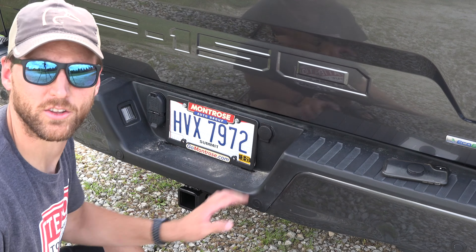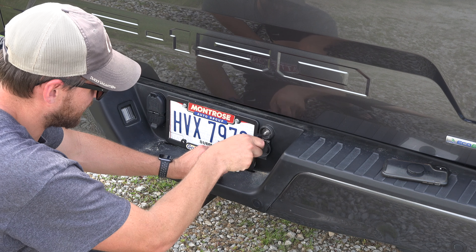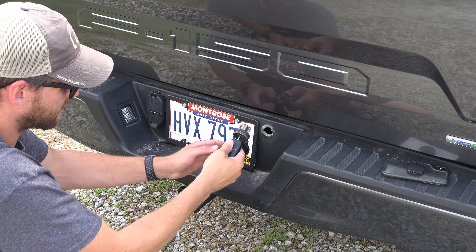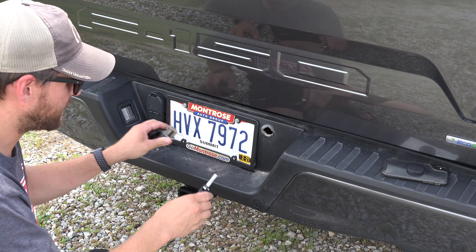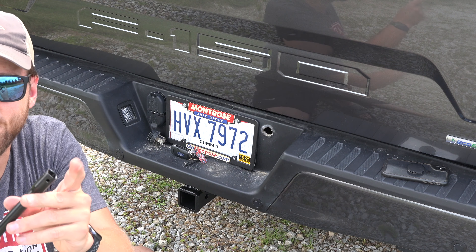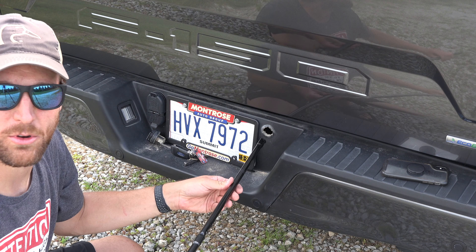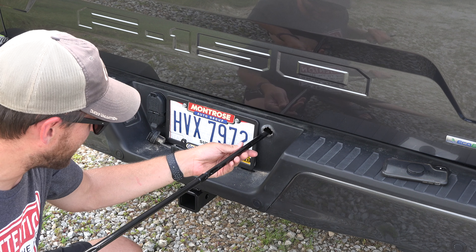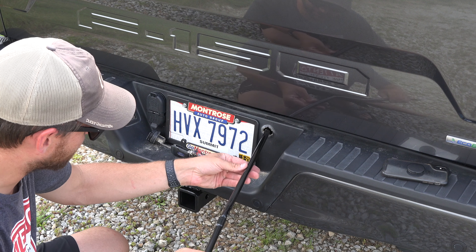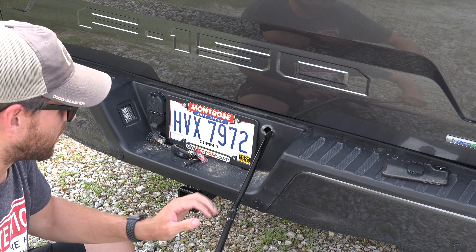To access the spare tire you'll need your car key. Pop this panel down, stick the key in, and turn it — it slides out leaving a hole. Stick the fat end of the rod in there. What frustrated me is I was trying to go straight in — naturally you want to go in at a slight angle.